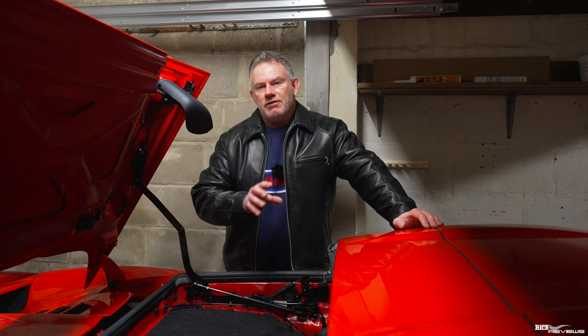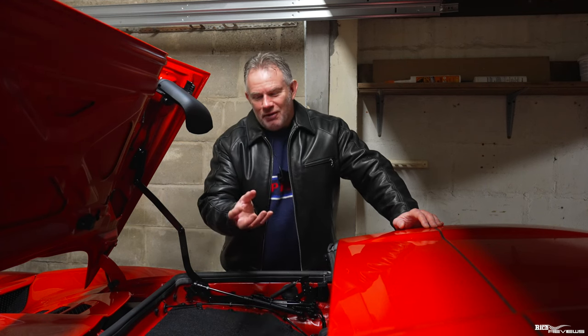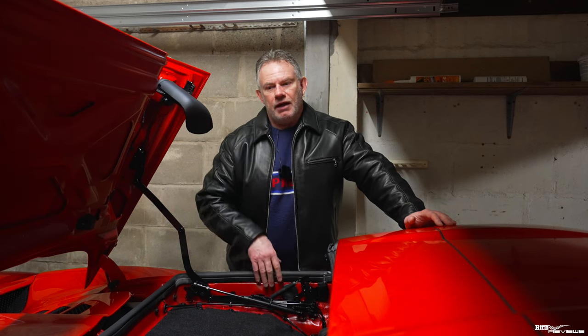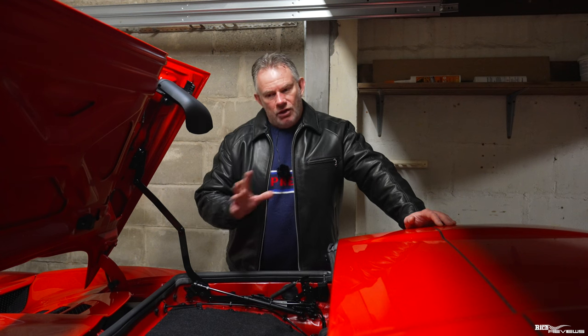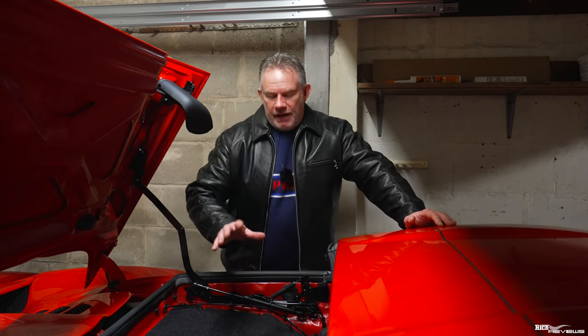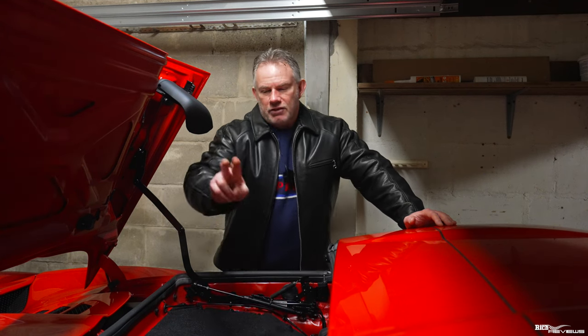These purge valves make quite a loud ticking sound once they reach a certain wear point, and this is a known issue on these cars. What Ferrari do is wrap both purge valves — one for each bank — in a sound-insulating wrap to reduce the noise, but they can still be quite audible. There are two fuel tanks, one either side, hence two purge valves and two diagnostic valves. We know the diagnostic valve failure is on the left bank. To access the purge valves on this Spider you have to lift the tunnel cover and unbolt the engine cover — the purge valves are located just underneath.